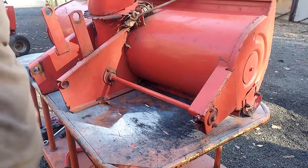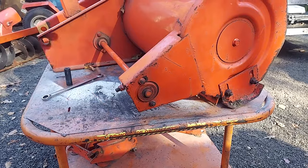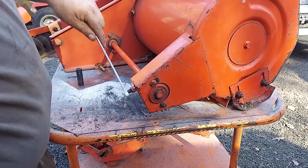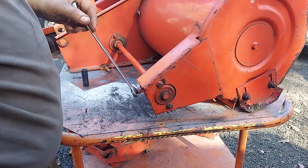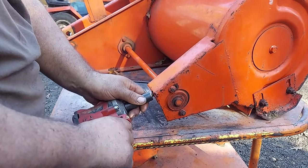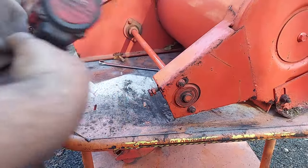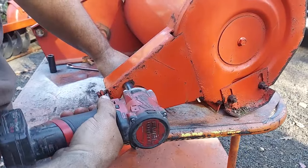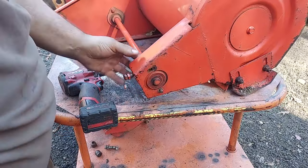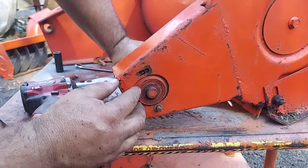You can disassemble your chain and back the adjustment off however you want. If you're replacing your chain, that makes sense too. I'm going to back this adjuster out — start it by hand just to make sure, because sometimes these are frozen and you'll destroy them, and they're no longer available. This one actually spins — it's taking both nuts, but that's fine. This is your adjuster for your chain sprocket tensioner. These are nine-sixteenths and half-inch nuts. The carriage bolts on the back — if it's spinning, get in and push on the carriage bolt. This slides in and allows you to move the jack shaft and bearing forward or back for tension.